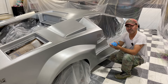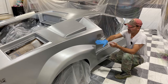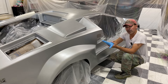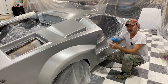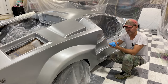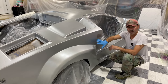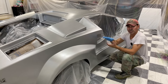I do have a spray gun as well, but I wanted to try this and see if it's all they claim it to be. We've let the paint sit a few days to properly cure. If the surface needs to be sanded down more, you want the finish nice and smooth before spraying. You can always use 2,000 to 3,000 grit wet sandpaper afterwards to lightly sand it smooth and buff it. Make sure the surface is free from any dirt, dust, and debris — wipe it down well, and get all sanding done before applying the clear coat.